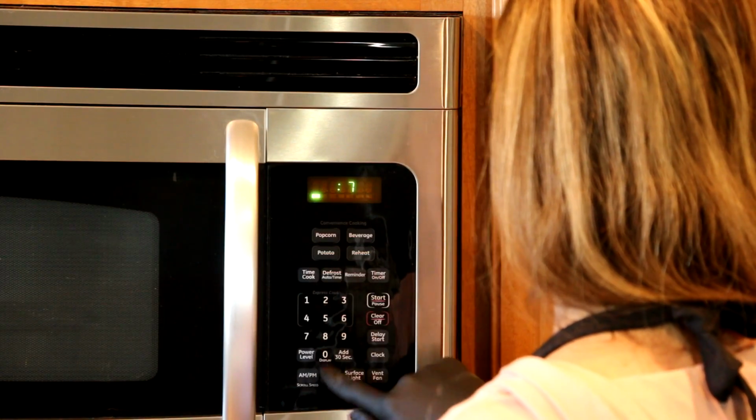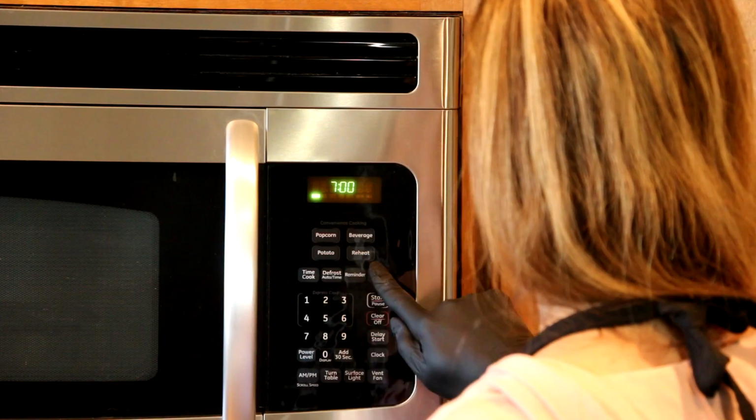I'll go 7. All right, you guys, I kicked the oven up to 180 and I'm gonna leave them in there for like another 5-10 minutes or so. These are really brittle old headlights, so I'm really nervous about prying these apart. The plastic is not as flexible as it probably was back in 1999. So this is gonna be a challenging set.